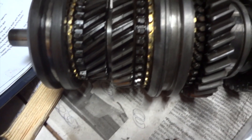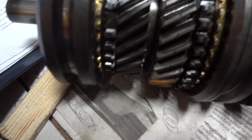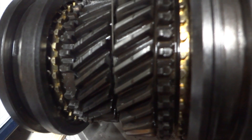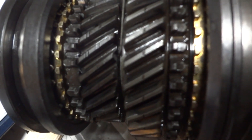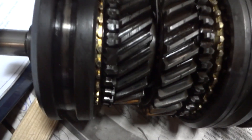Try to get your blade in there — there is no way the blade can go in there, so it's well within tolerance. Then for the second gear, I tried to get my blade in there. Here on the front side is for the third gear, and on this side here is for the second gear. The blade does not fit, so it's perfectly okay.